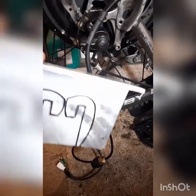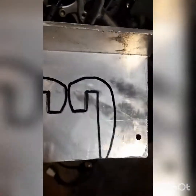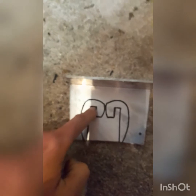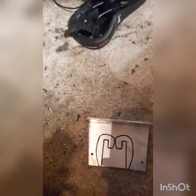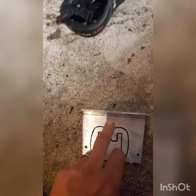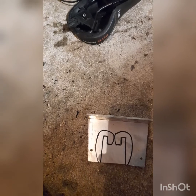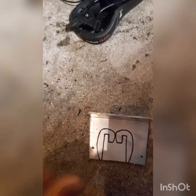I've transferred that template to an old piece of aluminium — one for each side — quite thick stuff, probably 4mm, maybe 5mm. We're going to drill a hole here and a hole there, the same size as the axle which I think is 12mm, and then use the angle grinder to cut the rough shape out and then file them nice. We'll see what happens next.